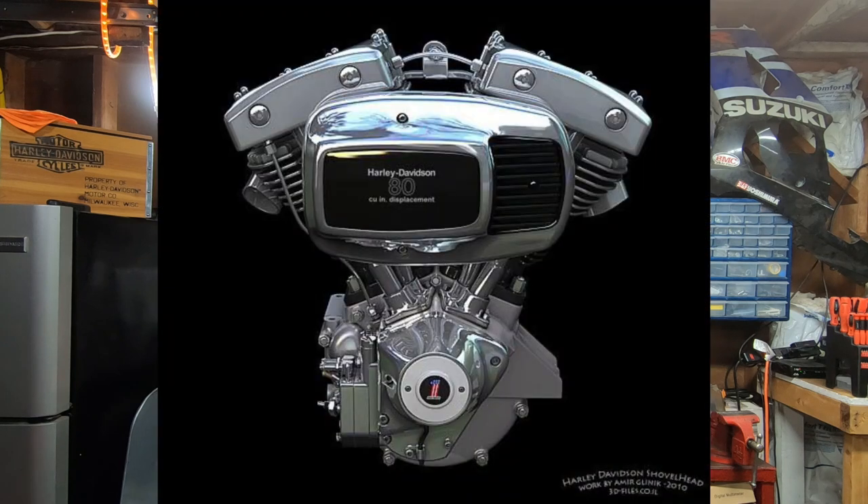In 1978, the 74 cubic inch Shovelhead grew to 80 inches. This was basically just a bored-out version of the 74-inch Shovelhead, but it had lighter pistons, a new head design, electronic ignition, higher compression, and redesigned intake manifolds. While this combination didn't create any more power than the 74 cubic inch version, it did make that power more usable, and the bike ran much better on the new unleaded fuel and the leaner fuel ratios they were dealing with at that time. Basically, what we saw in the 1970s was an engine designed pre-1966, updated in 1966, and with changes in fuel and emission standards in the 1970s, coupled with AMF running things, you can really see how things went downhill for the Shovelhead.